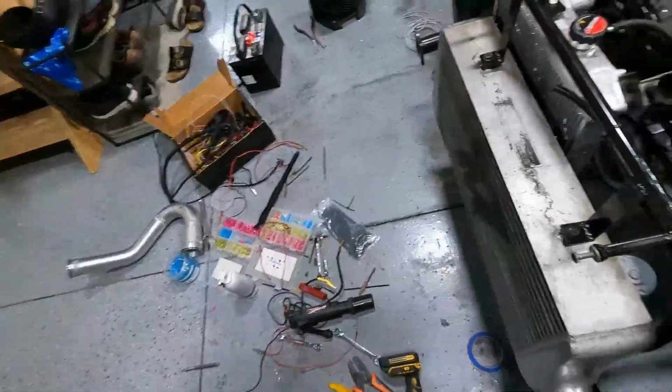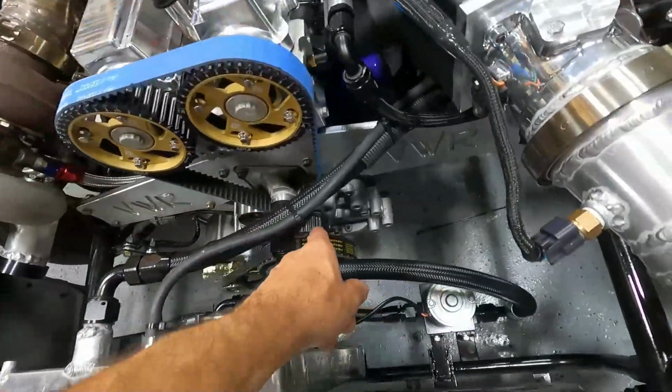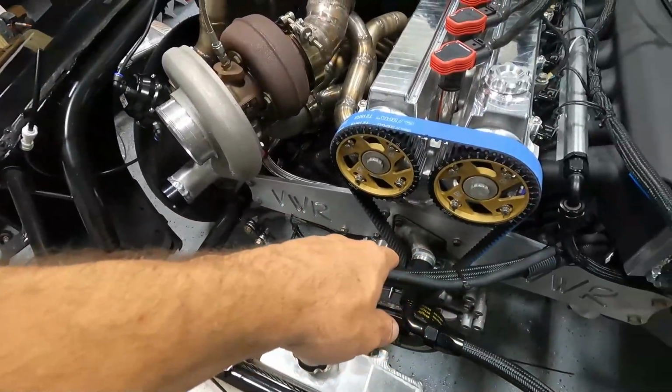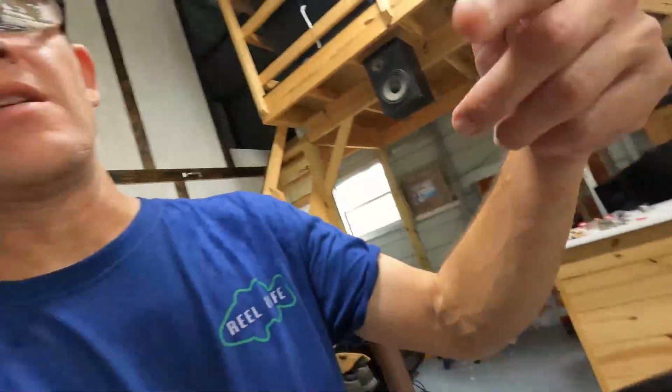I'm not going to really show you in the ECU, but since we're running a GE and I'm using a VVTi gear for the crank pickup, which is 36 tooth with 2 missing, or 32 and 2 missing, I forget, I had to make a little change in the computer for that. The cam pickup is 1. There's only 1 pickup on the cam, whereas on a VVTi there's 3. So I had to change that as well, and then change the ignition start angle where it starts.